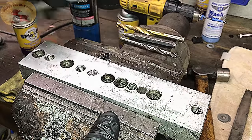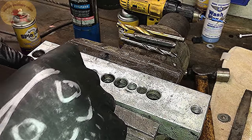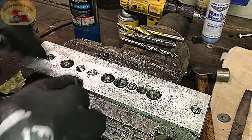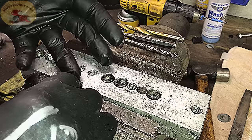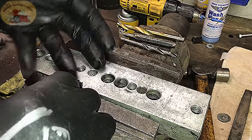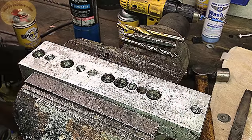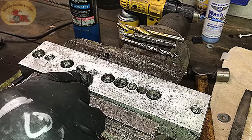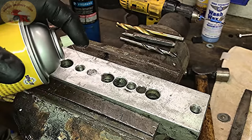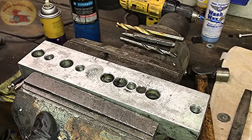Here's a tip we use: many of you will take a broken screw — you can see this one is all jagged on top. If there's a little bit sticking up above the surface, a lot of times you can get needle nose vice grips on it, grab hold of it, and turn it out. If we know we're pulling a bolt that could twist off, we'll spray penetrating oil on it a couple of days beforehand, let it set, and go that route.